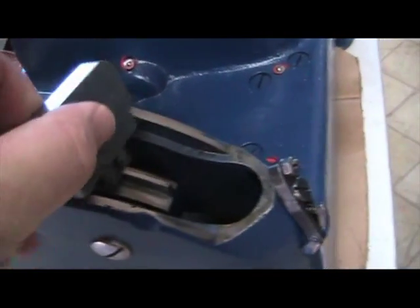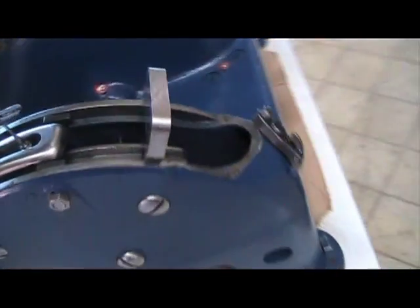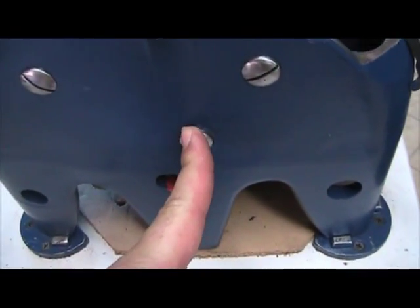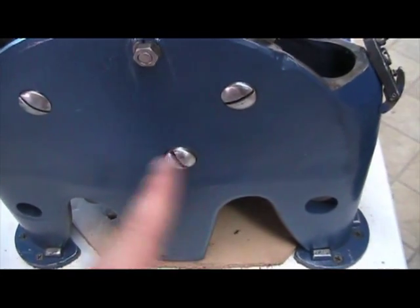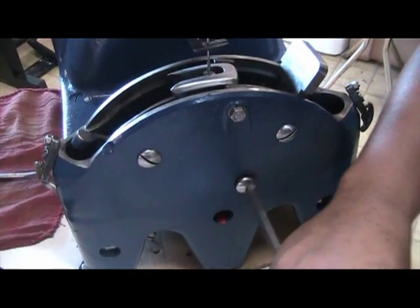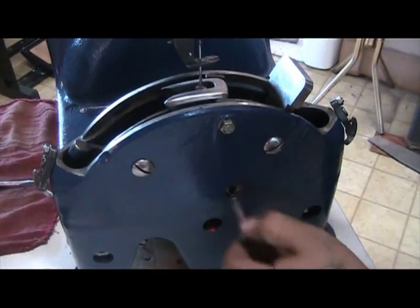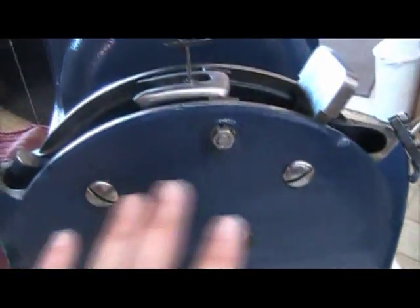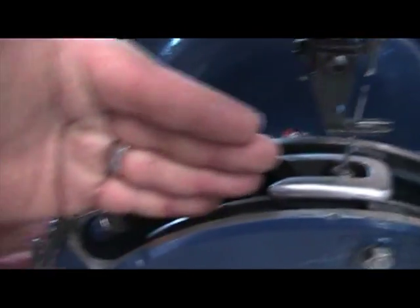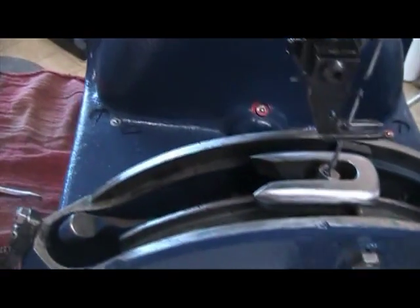You check it on the left and on the right side of the machine. If it's not in proper position, you're going to want to loosen this screw, pull it out, and back off that lower bushing a little bit using a wide-tipped flat head screwdriver. You release that screw — there's a bushing there that pushes away or allows the needle bar stand to be sucked in closer to the frame. You adjust those bushings in or out to align the angle of that needle bar frame to be in proper alignment.